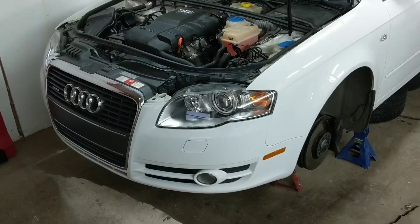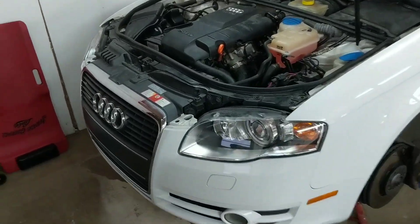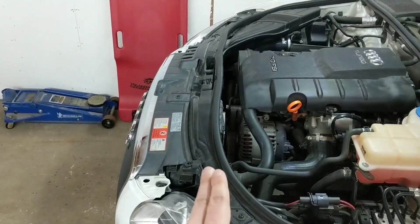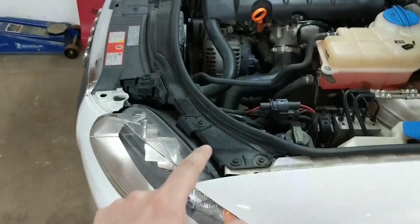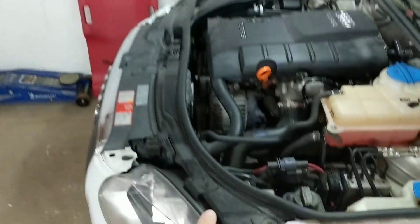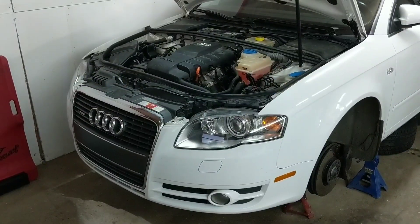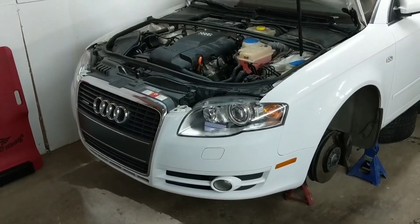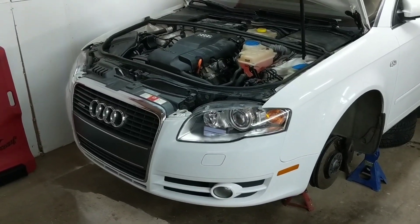In order to fix that problem permanently, I'm going to have to take out the lower core support. That piece is just one of a few that makes up the front carrier — this entire front section right here, basically everything from here to there as an imaginary outline is going to have to come off. So even though it's more work than I ever counted on taking on, in the true spirit of this channel — me learning things the hard way and doing the research so you don't have to — I'm still looking forward to it.